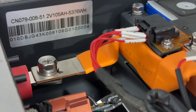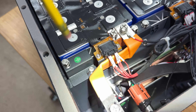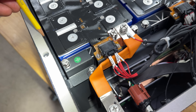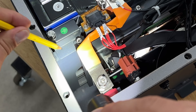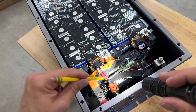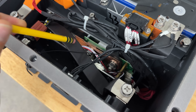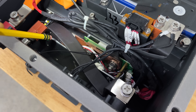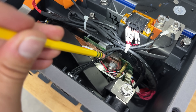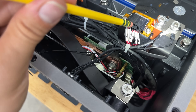I think that's just kind of fascinating. Rather than just these extruded aluminum pieces, those pieces are bolted to the bottom of the battery, but you've also got this entire casing — a gray steel piece going all the way around the battery as a kind of inner casing around all the cells. The BMS is bolted to that casing too. So the negative cable coming in goes through a flexible copper bus bar down to the BMS, which looks like it has an actual relay or contactor to completely disconnect it. Outside of that contactor or relay, it goes to a copper bus bar where there's another semi-flexible copper bus bar coming up to the battery terminal.